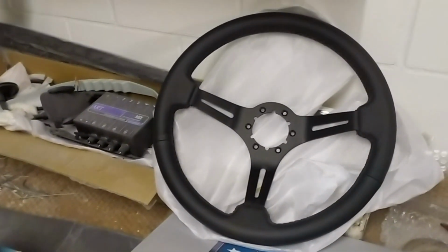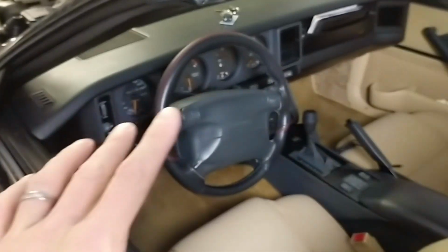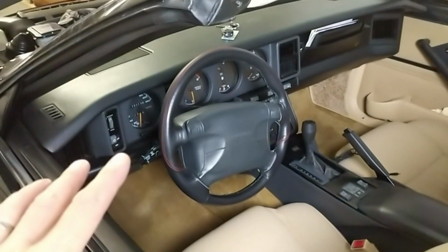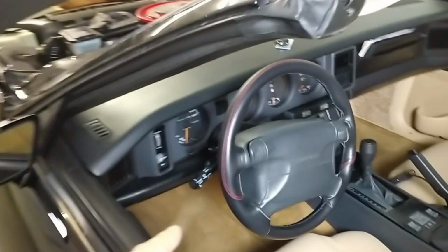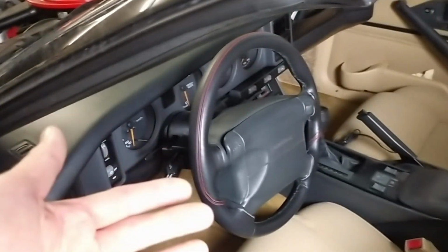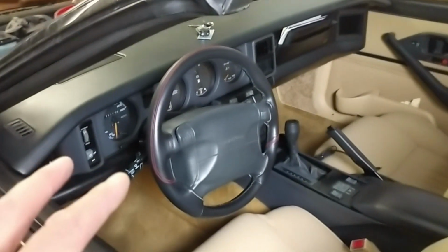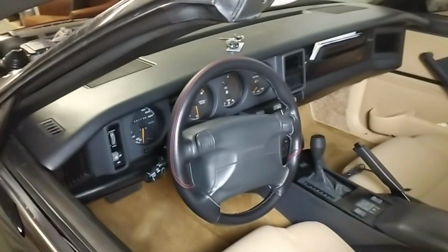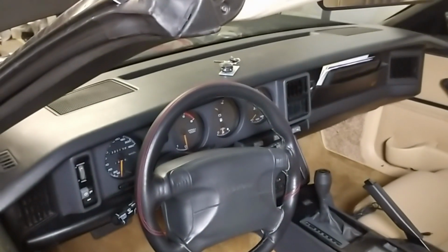But first off, we need to take the old steering wheel off. I already have a video on how to take the steering wheel off, from when I changed the turn signal springs. I'll leave a link in the description. I had to take the steering wheel off, so you can see that in detail. But the major point here is that you also have to deactivate the airbag for good, so that the airbag light inside will not pop up again. Let me show you what I mean.